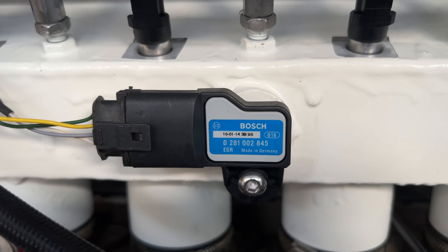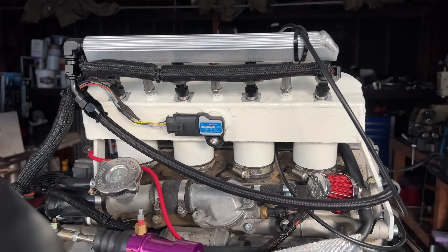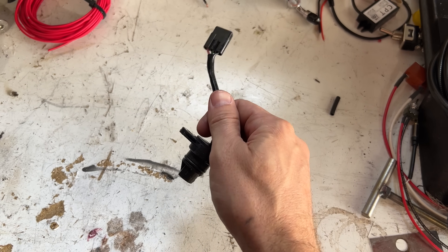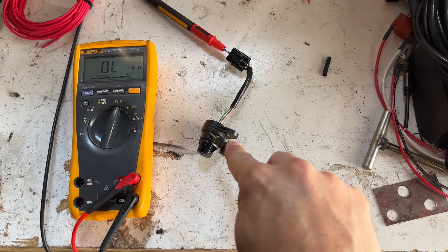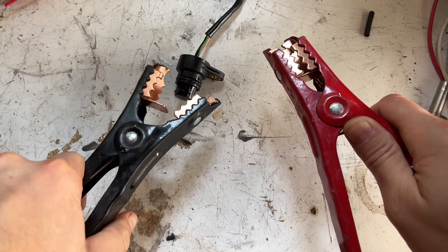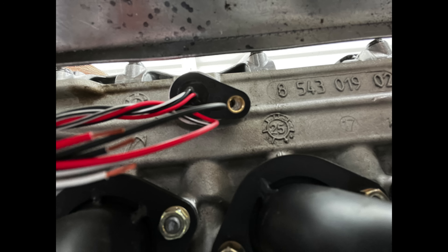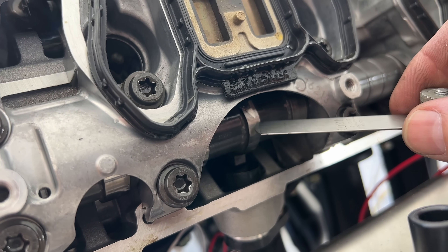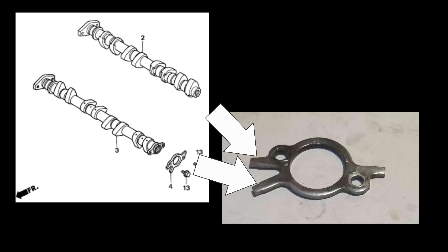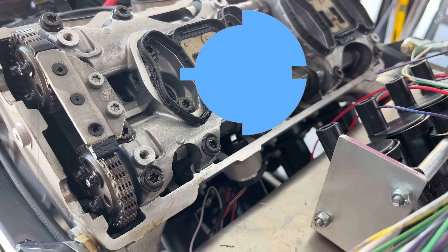I'm using a combination pressure and temperature sensor for the manifold. These are pretty cheap and robust — they put them on a few turbocharged Mazdas. It's good for three bars of boost. I found the datasheet online to program the ECU and verified it with some bench testing. The cam sensor that came with the BMW had three wires, making me think it was a hall effect sensor, but I didn't know if it was 5V or 12V or which wires did what. I kind of just prodded it with a multimeter, then prodded it with some voltage, before realizing I wasn't getting anything expected out of it — which means I probably fried it. So I called up DIY Autotune and got one of their hall effect sensors. The sensor needed to be modified — I had to drill out the hole for the screw and make a spacer to get the right spacing to the trigger wheel. The trigger wheel was another issue: I need one trigger per revolution. On my Honda I just cut off two teeth of the trigger wheel, but the BMW has the trigger wheel cast into the camshaft. So I had to remove the exhaust cam and carefully grind off all of those parts. But now it works.